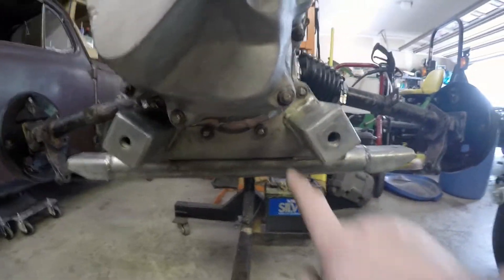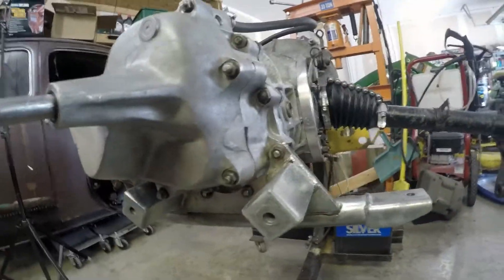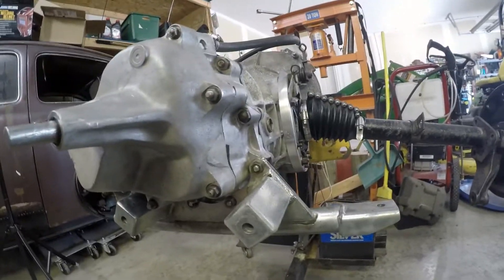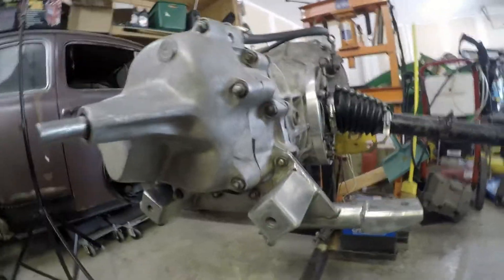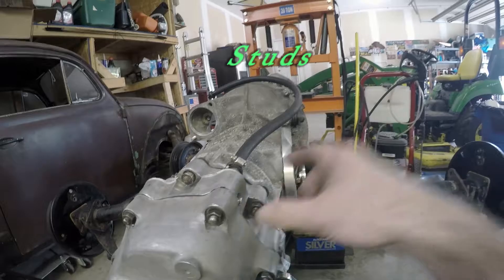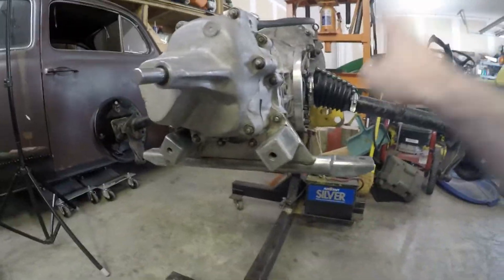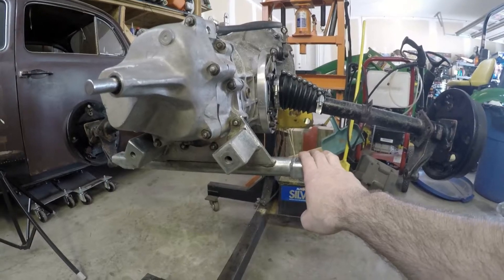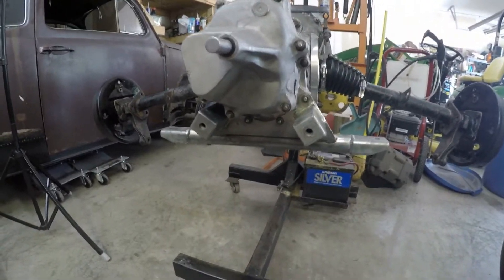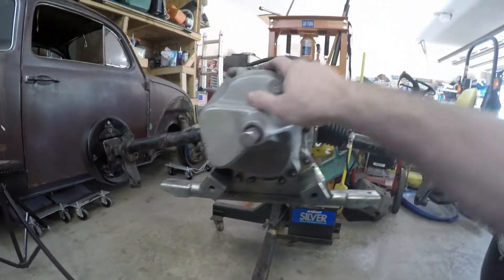As you can see, it utilizes one, two, three, four of the bolts on the transmission case here. You have to install longer bolts or studs on the lower part. The neat thing about it is if you have a spare old transmission case, you can use the four top bolts up here because they are long enough.